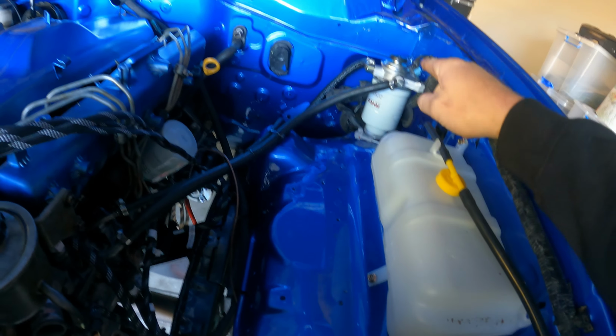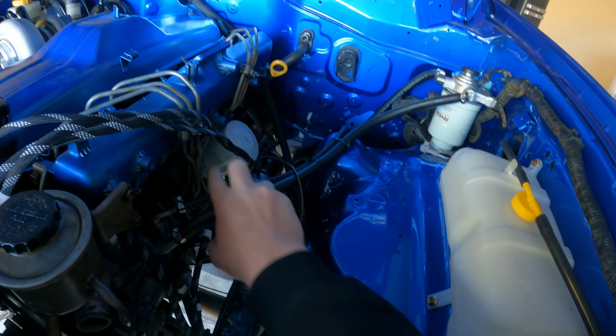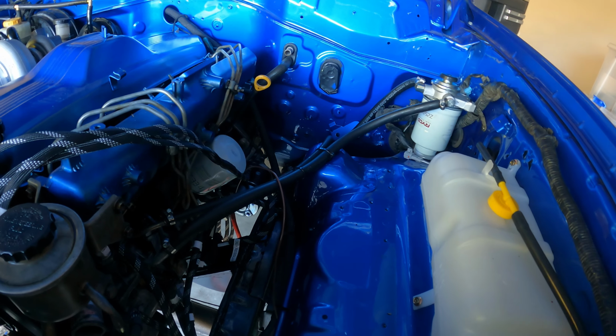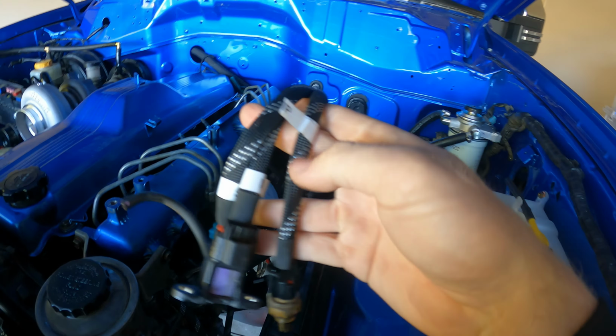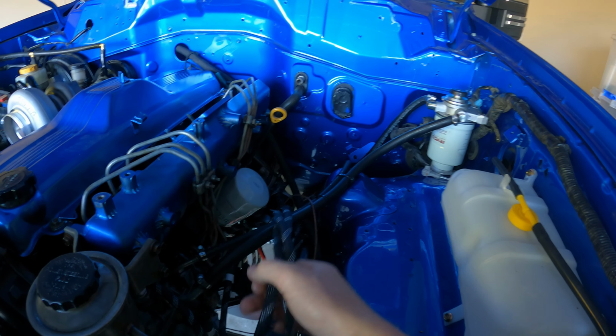Radiators in, shrouds in, fans in, belts are on, vacuum lines are done, overflow tanks on, fuel primers on, fuel lines are ran, which we've done a 12mm feed and an 8mm return, going down the passenger side of the car to make it all neat. Ran the loom already, that's a Mick Wallen loom, everything's already labelled out for you, ready to go. Pretty simple setup, about 3 or 4 wires to get the motor to run. And it's a fresh brand new loom, which is awesome.